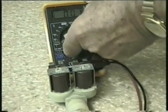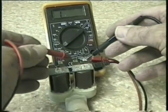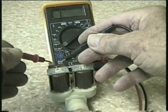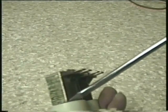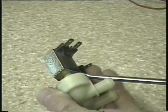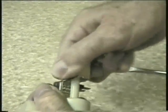Or you could have an open circuit coil. Use a meter and test it for continuity. If found to be faulty you could swap coils over with the fabric conditioner valve — by this valve not working the machine wouldn't stop, but it would mean your washing wouldn't have any conditioner in it. This would only be a short term fix to get you out of trouble, because although the original faulty valve would now be working, the fabric conditioner valve would not. Before you start, make a note of which wires go on which coil before removing them. Then using a flat bladed screwdriver lever the coils off, but be careful because they are a tight fit and you could damage the piston housing if not careful. Swap the coils over and refit the wires.